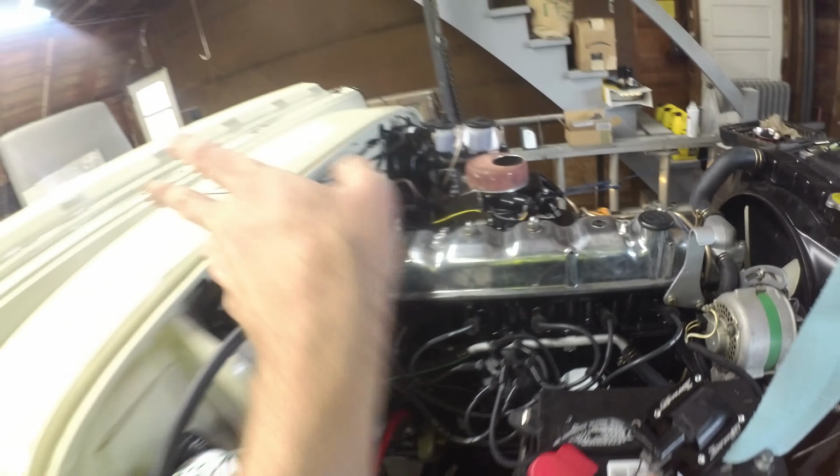And I did recall you do want this in before the windshield anyway, because the big windshield knobs go through it. They kind of run through these big holes on the corner. So when you pull the windshield up, those pins come forward, hold the windshield upright. So you do kind of want the dash in first.